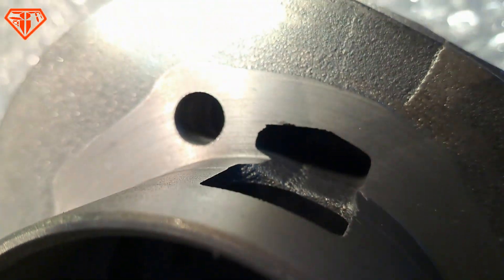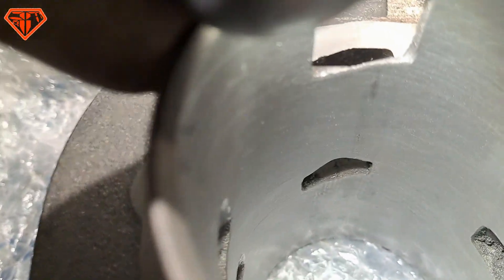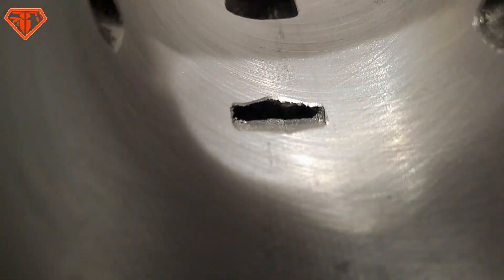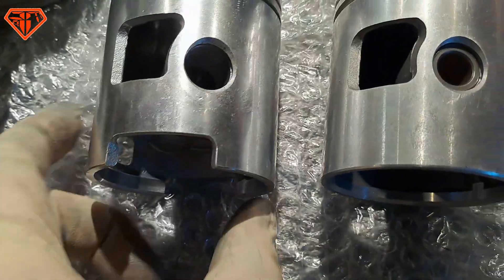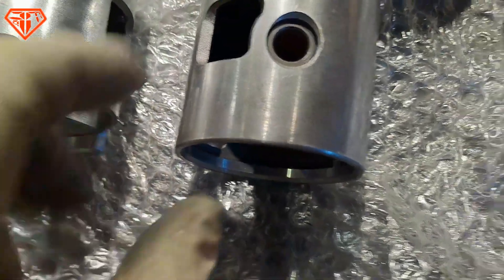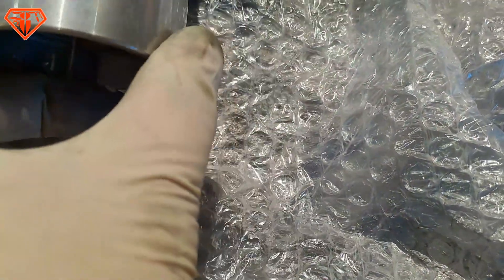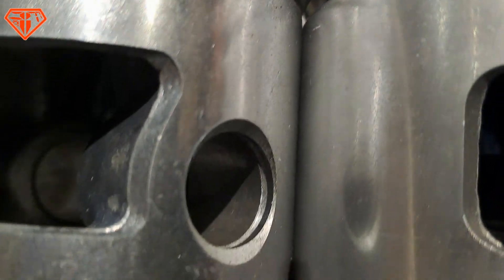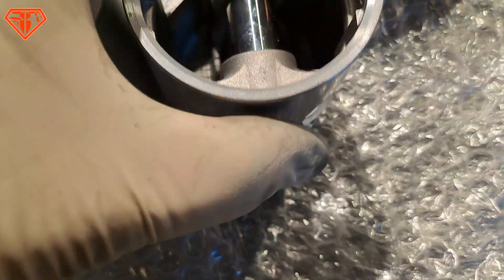Not everywhere — they forgot something here. What happened to the boost port? This is Piaggio — shouldn't it be like that. Cut out. Boost port window: Piaggio has two, Zip has 1.5.